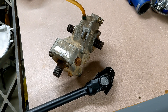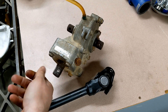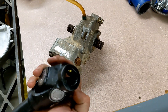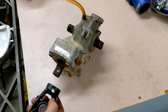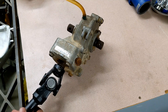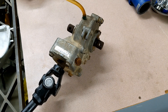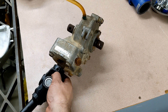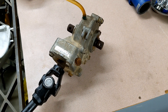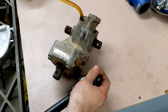This is out of a Polaris four-wheel-drive ATV. The splines are 22-spline and they take a unique universal joint. As you can see, this universal joint has the splines on it. The nice thing is you just slide it in, and instead of using a roll pin to secure it, I'm using a grade 8 bolt through there to make disassembly easy rather than having to drive a roll pin out every time.